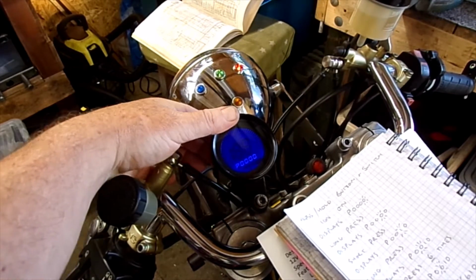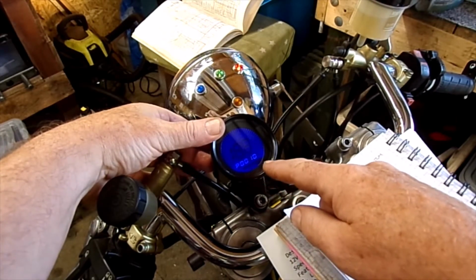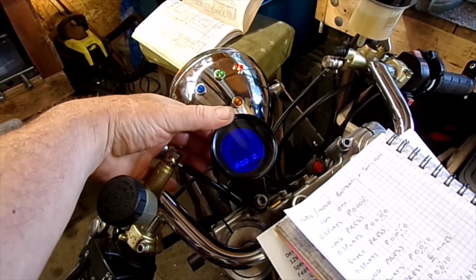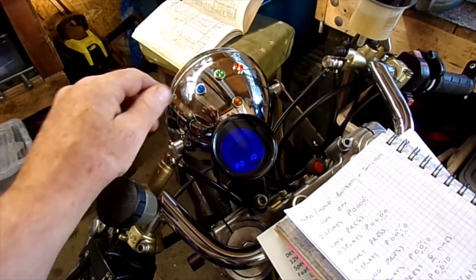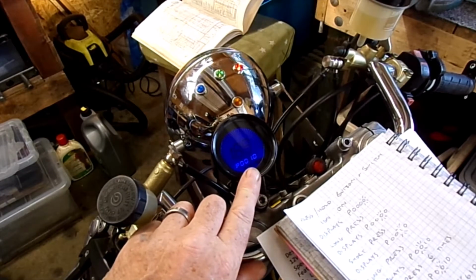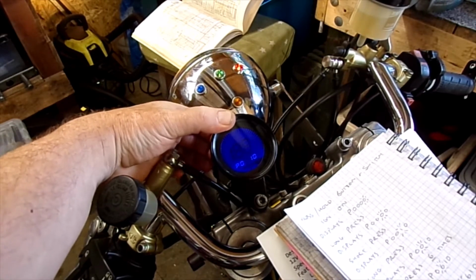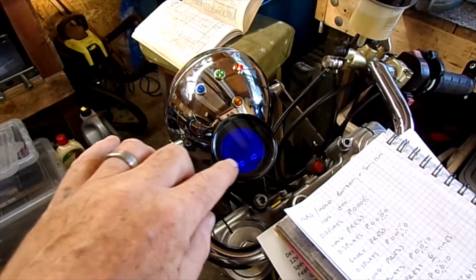Right, a short press changes that to a 1, so we've now got P0010. A long press should take us to the next digit along. So P0010, and that second 0 is flashing. Short press 6 times. So now we have P0610, the 6 is flashing.